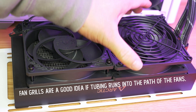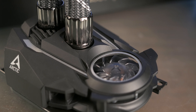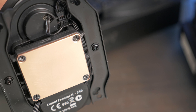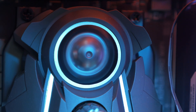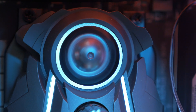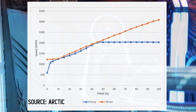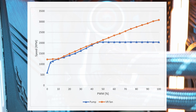The pump block is a very interesting shape, and there is a built-in 40mm cooling fan with a tiny cable that will blow air in the vicinity of the pump block to cool your motherboard. On boards with weak VRM stages or cases where airflow is just terrible, this could be a saving grace. The pump block and VRM fan follow the PWM signal provided by the motherboard or fan controller.